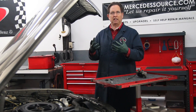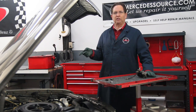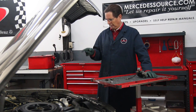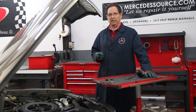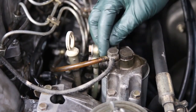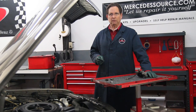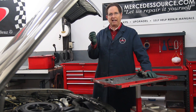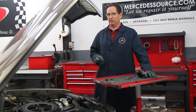Cold temperature combined with dirt and crud can cause a fuel filter to start to plug up. As I said in a previous video, fuel systems and fuel filters are one thing I really go after in my pre-winter driving inspections. In this one, I want to change one of my plastic hard lines — there are three that connect to the fuel filter housing in these old 617 and 616 diesels. I noticed one is starting to show signs of wear and cracking around the nipple, which is where they usually fail. I had one of these fail once, and you cannot believe the amount of fuel you will literally dump on the road — the engine keeps running but you're talking gallons pumping out.